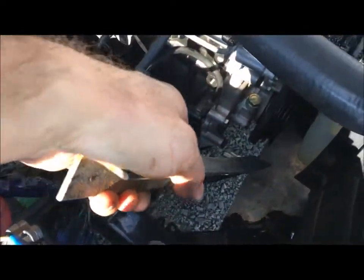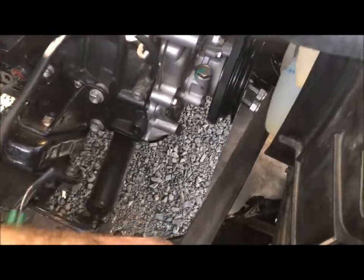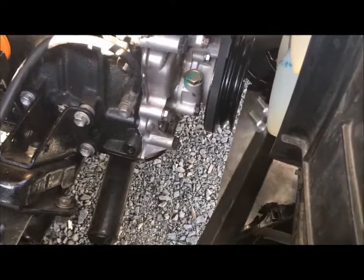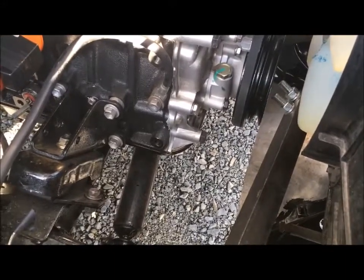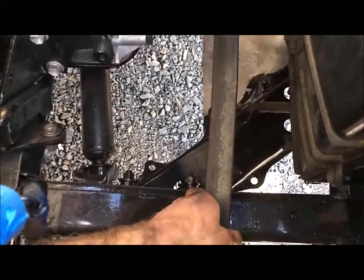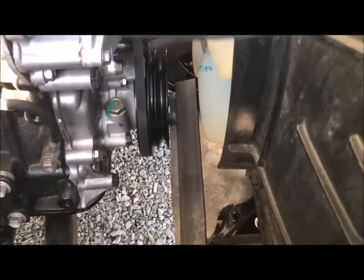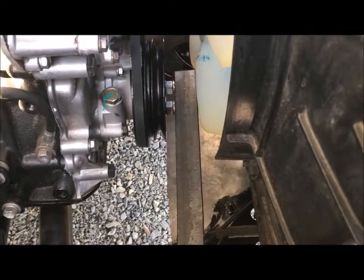The way this thing goes in — before I had the radiator and everything back in, I had all this stuff out of here, so you had a lot more room. That's how you take this thing off; you don't do it with the radiator and all this junk in the way. You slide these bolts in there and they lock into the slots located in the crank pulley. The bolts at the end of this piece of angle iron are placed just so they fit into those slots and make a pretty good lock. Then the end of this tool just sits against the frame rail right there, giving you counter-leverage — it locks that pulley in place so as you're putting torque on the crank pulley bolt to get it off, this thing locks it very positively.